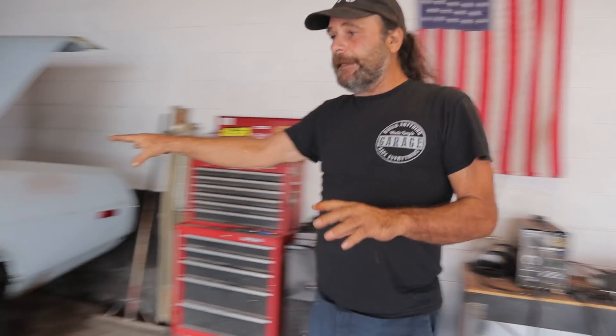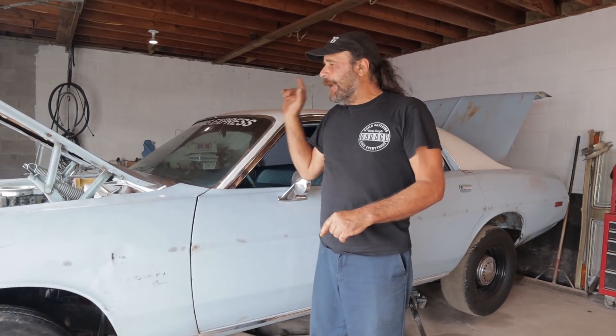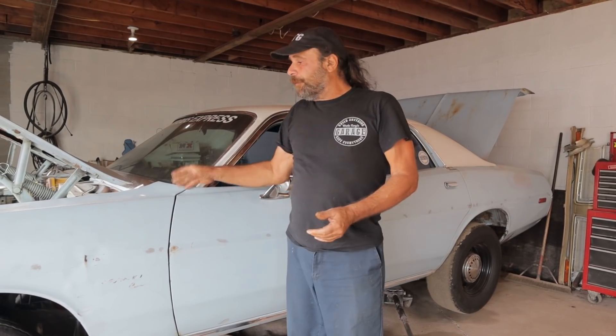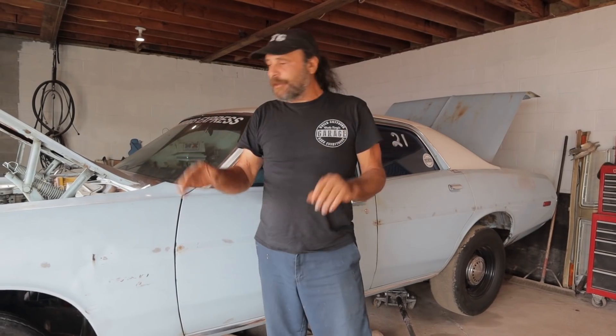First, let me bring up the speed on Vital Rocket here. We took our pressure plate over to Nashville Clutch and Supply and they put it on their machine. It had just under 700 pounds of clamping force — it should have been around 800 to 900. They juggled springs, swapped in a couple of stiffer springs, and now it's just over a thousand pounds — 1,020. I put it together last night. The clutch pedal feels great, everything is good to go.